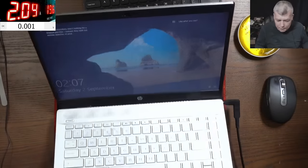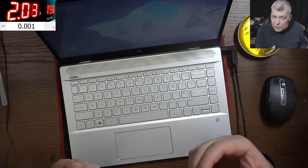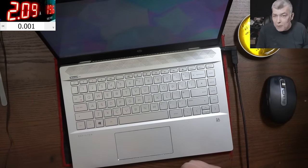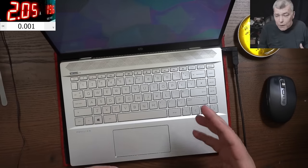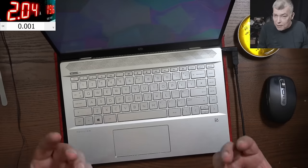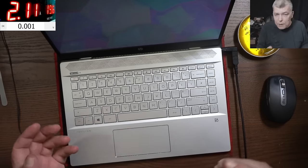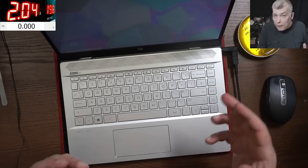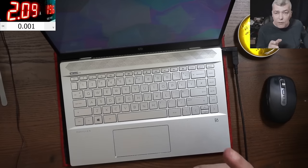So the laptop is all back together. Charging fine, working fine. But what I want you to keep in mind is the way we diagnose, roughly, the problem from the beginning. You remember? The caps lock light. Caps lock can give you an indication of where the problem is. If the caps lock doesn't work, you have a processing issue somewhere. It's a miscommunication with the CPU, chipset, even the EC chip, BIOS, anything.